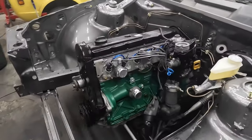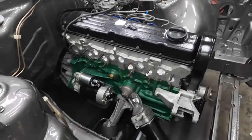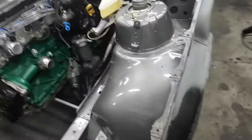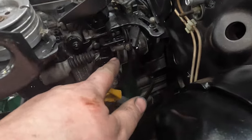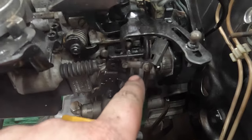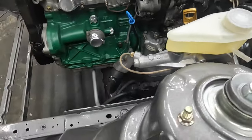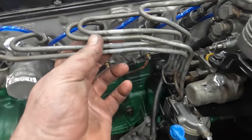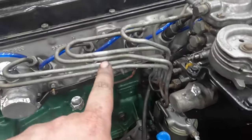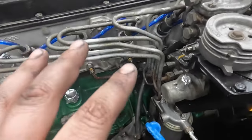Now that's quite the milestone for this build — I'm pretty jazzed at the moment. I got all the orifices I don't need yet covered up to keep the bugs out. I believe I forgot to mention that you've got to reactivate the little cold start compensator — just put that guy back, tighten that screw back and make sure it does the thing. I also found my little separator clips — you want to put those on before you tighten all your lines down so it holds them nice and good. You risk cracking a line if you don't do that — all of a sudden you'll feel like you're running on five cylinders at idle, then you'll blip it a little bit and all six will come back.